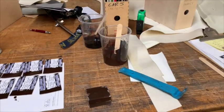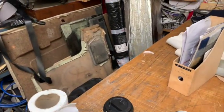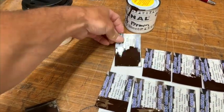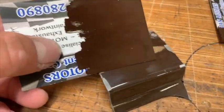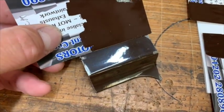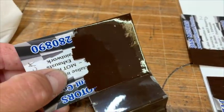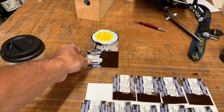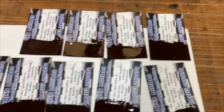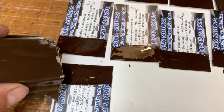Here is a piece of Volvo that I've cleaned up. This one here is number one, which is the colour that came from the paint shop. It's kind of hard to see in this light but it's way more red than brown. I've chatted to my old boy Harry, an old school painter — he says the shade variants were generally colours working off the same chips, so basically just keep adding black. So here we are: four drops, eight drops, 12, 16, and I've gone all the way up to 40 drops at the moment, which is getting me closer. Still a bit too much red, so we'll see.